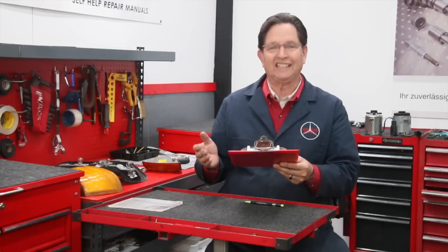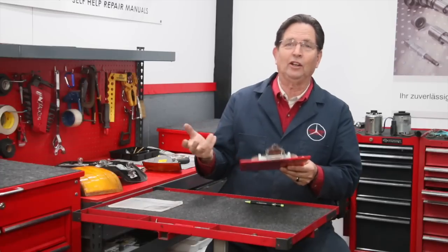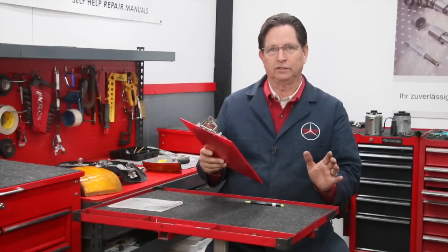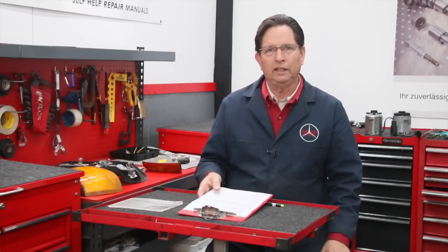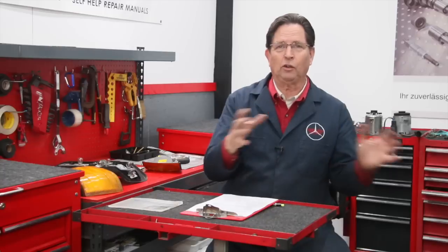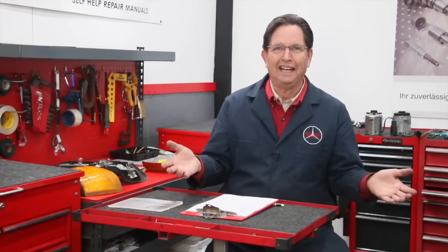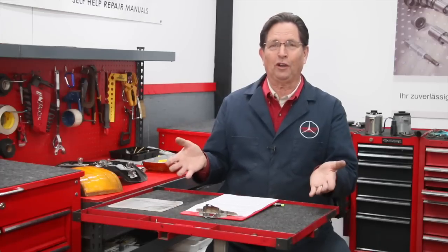He goes on to say all the cable and sunroof removal guides online say you need to open it up a little bit in order to remove the headliner panel and get the cable locking clip loose. That's very true. My whole series of videos on the tilting sunroof as well as manual sunroofs came from frustration years ago at not being able to find good information on how to repair these sunroofs. It starts with lubrication — if you're not lubricating these sunroofs they're going to fail: broken angular tilting arms, stripped cables, worn-out motors, stripped motor gear drives. Every time I pull one of these apart it's lack of lubrication. I'm going to show you now — I have one I recently removed from a W126 sedan, a 1981 model — to show you why you need to remove the sunroof panel in order to lubricate it properly.